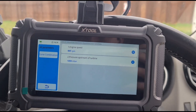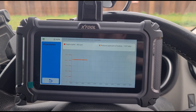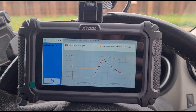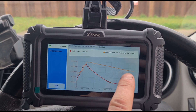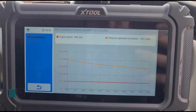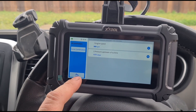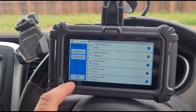We've got two items here and we can just concentrate on these two — we've highlighted them. We're going to start the vehicle up and give it a rev. You can see there's a delay on the upstream pressure — that's still coming down. So we've got the option of using the live data on this tool to pinpoint what sort of faults we have — that's one of the issues there of course.